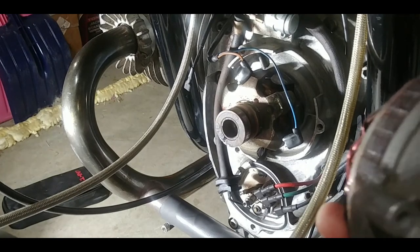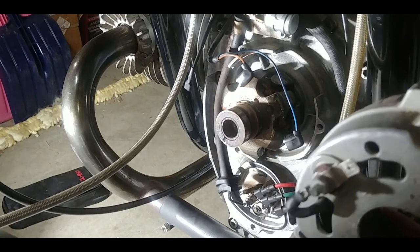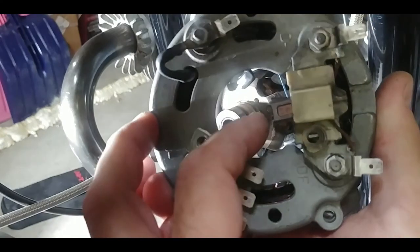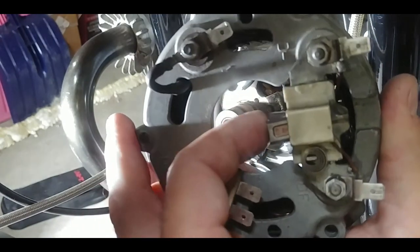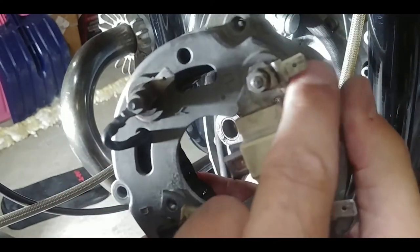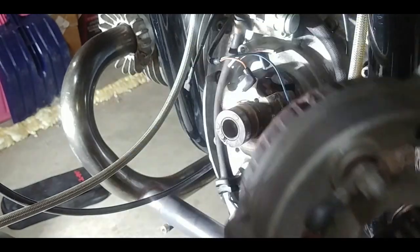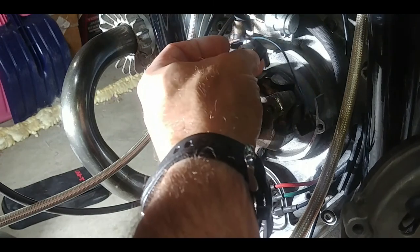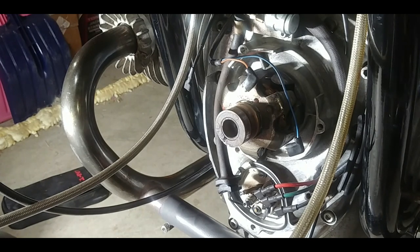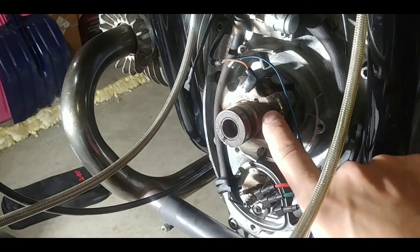I actually have a new set of brushes that I will most likely install during this repair here. Unless the ones that are in here — they look pretty long, to be honest. Maybe we replace them, maybe we won't. Definitely we'll clean all the contacts here. All the spade connectors, they need to be pristine. The female connectors I kind of bend them together so they really put a nice strong pressure on all the connections. Securing the stator over here, out of the way. Now we need to grab a tool — I go and grab my rotor removal tool.